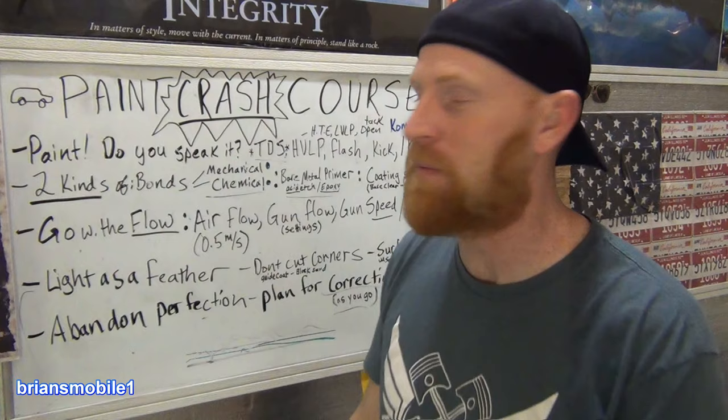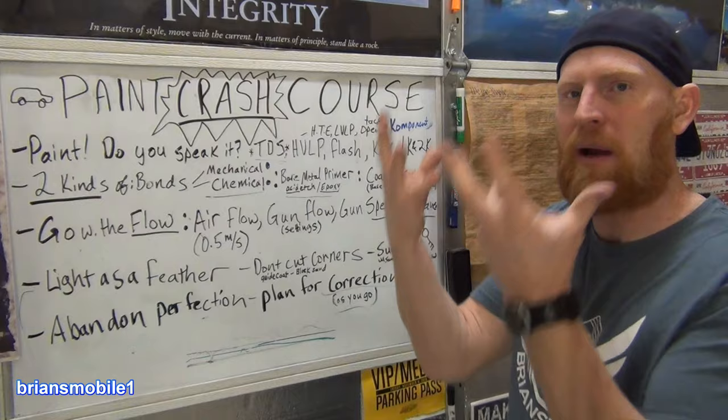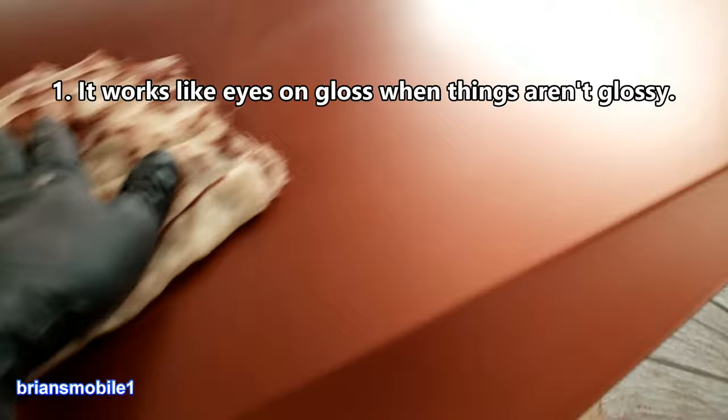Surface is key. Make sure that it's clean. Wax and grease remover, window cleaner, something like that. Dry cloth over after to soak up anything so that nothing can evaporate up through the paint and make pinholes. Once your surface is smooth and it's free of any wax or grease, the next thing you have to do is the tack cloth. This does a couple of things. It finds any kind of bump, any kind of imperfection, any texture problem, but it also gets any kind of dust. It sticks to the tackiness of the cloth. Don't forget the importance of this step.